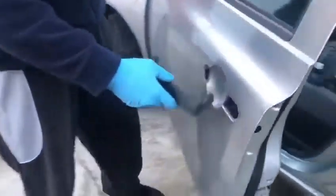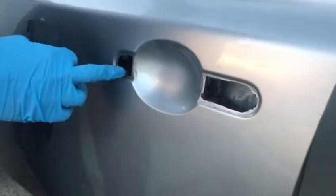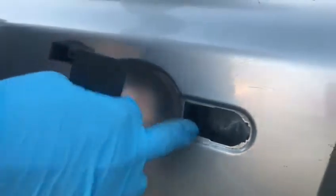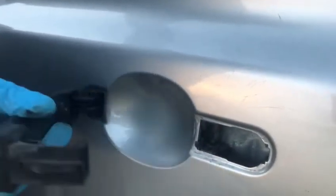So what's the first step? This door handle. Yeah, so we pop the door handle in first. Because there's already a plastic mechanism sitting at the back, we haven't touched it. Remember, just make sure it's this bit here that unlocks the door. That sits in, it slides in kind of here, behind it. Just remember, before you put it in, push these black little grooves towards the bonnet front end, so it slides in. So this can't move now. Oh, right. So we slide this in first, in there.